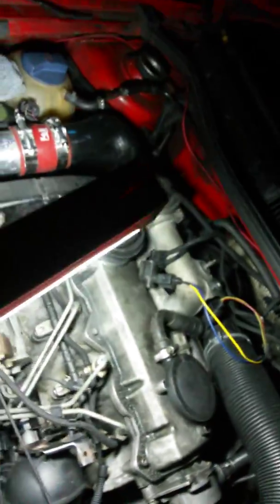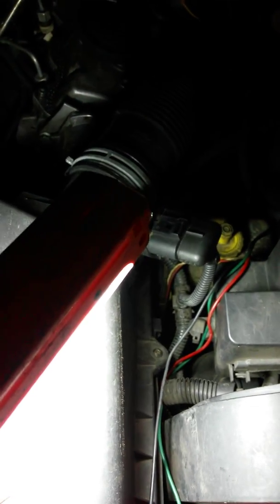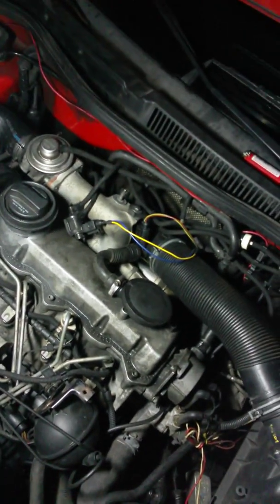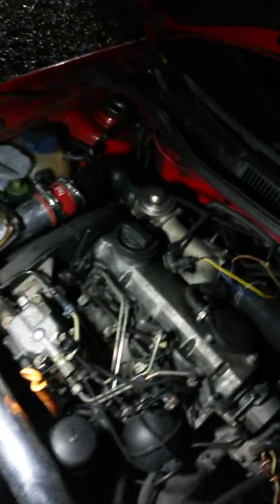And it won't take the abuse. So now I'm going to wrap these wires with electrical tape and mount this solenoid. I've solved one problem — now I'm going to go take a look at these mass air flow sensor wires up under this insulation cover. I'll bet they're all chafed up, probably causing that mass air flow sensor code to throw. If they're not chafed underneath there, then it has to be the plug. I'm pretty sure it's the plug, but I'm going to check the wires anyway. I've resolved one of the last two codes I've got going on this car that are worthy for me to address. Anyway, over and out — you got a rough idle ALH TDI running like a turd.